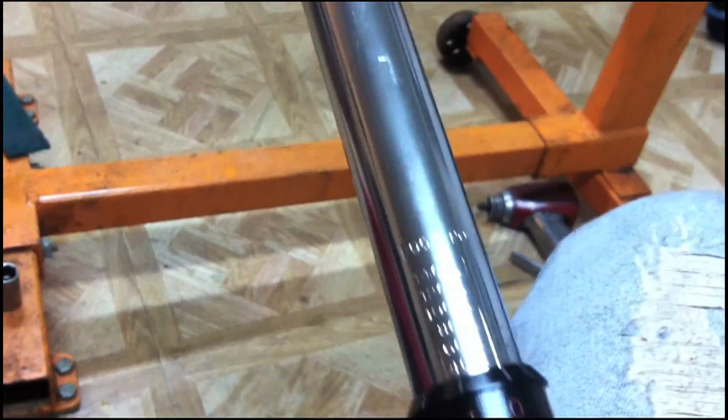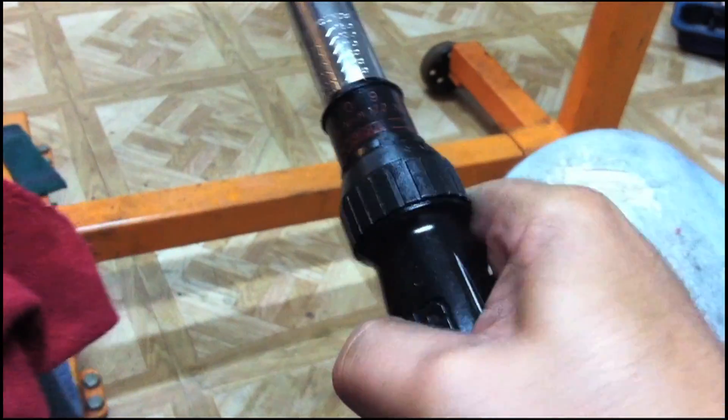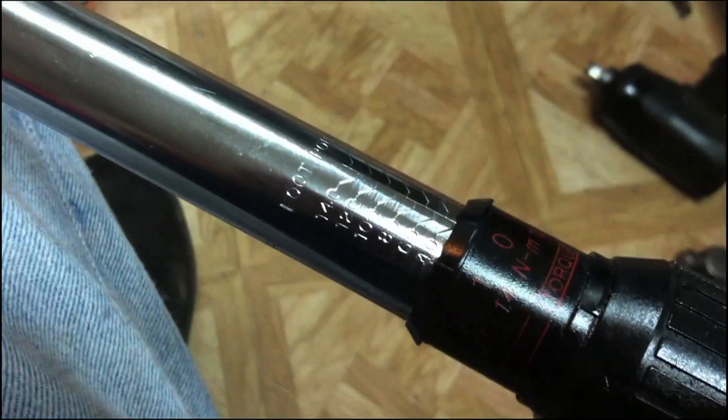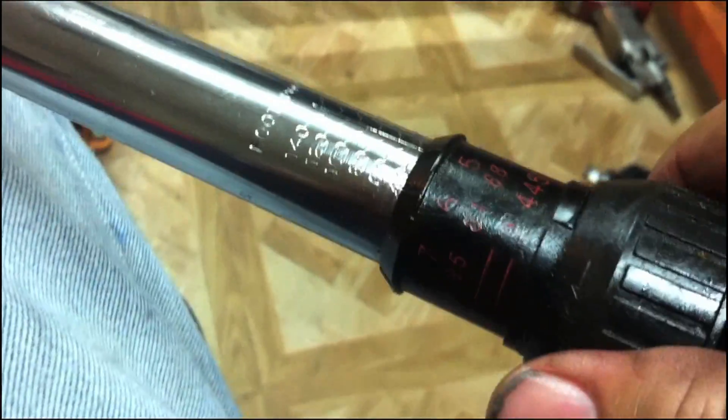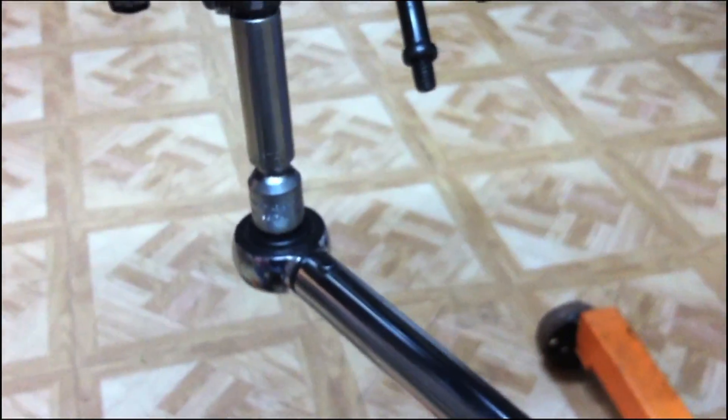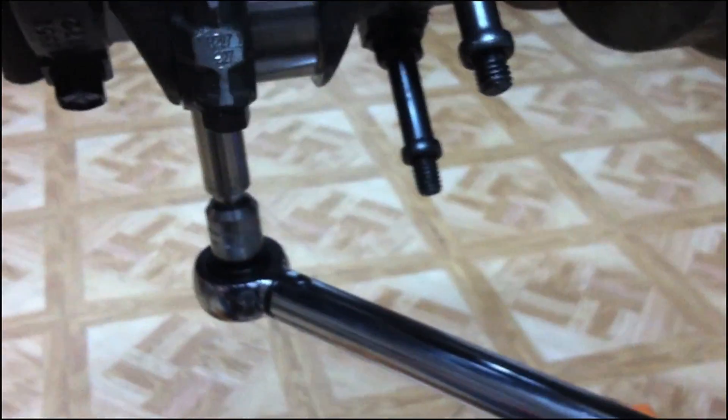For anyone not familiar with a torque wrench: this one is a Craftsman. It has a little dial on the handle that spins and tightens up to the numbers — you line up the notches to tell you exactly how many foot-pounds or inch-pounds you've set. We're setting ours at 45 foot-pounds — 40 on the main scale and five on the handle — then lock it so we don't lose the setting. When you reach the torque on the stroker 383 Chevy rod nut, you hear a big click, which means it's set correctly.